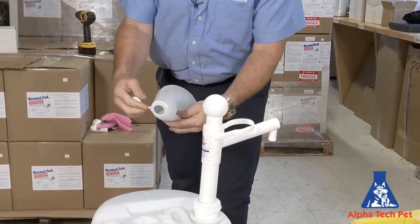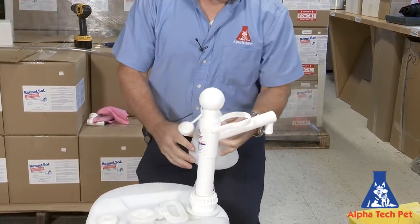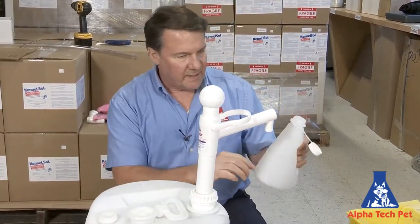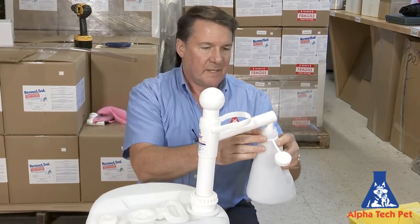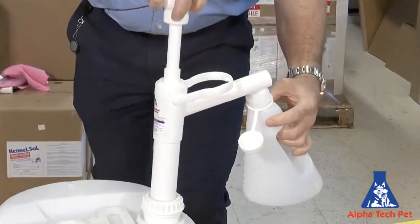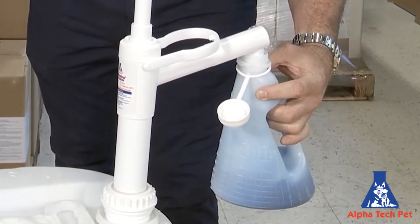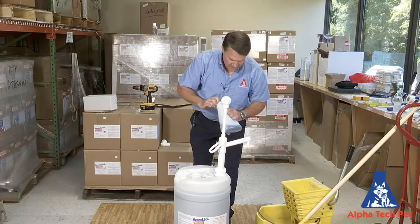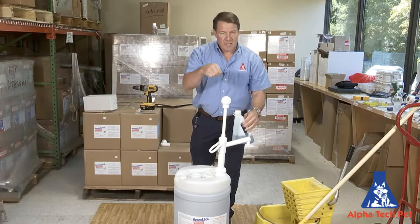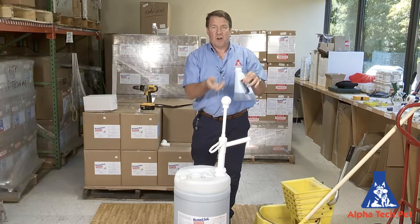In addition to the pump, you can also get this as a separate device — it's a safety measuring kit. So if you'd like to measure exactly how much each stroke pumps, you'd buy this kit. And then you can just pump it — that's one pump. If you want to really do this the correct way, you're going to pump two times, fill this up, and then you're going to know exactly how much solution you're drawing with each pump.